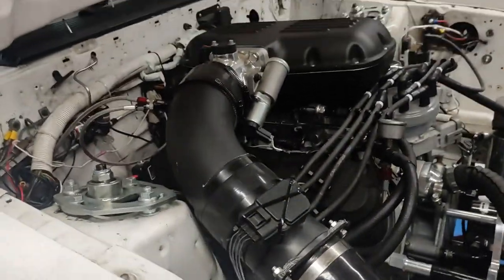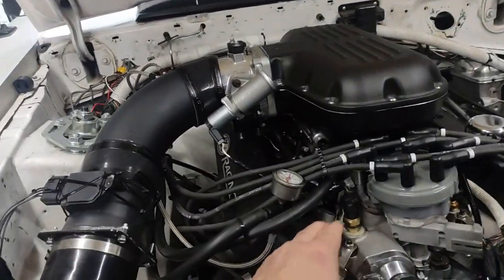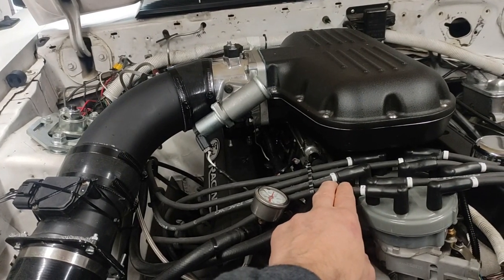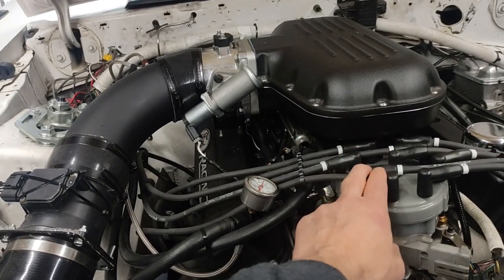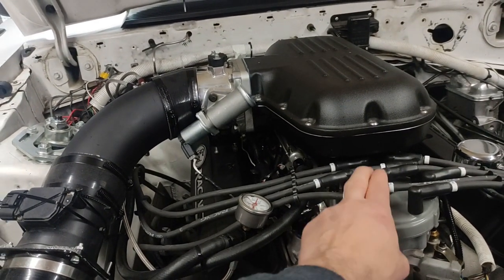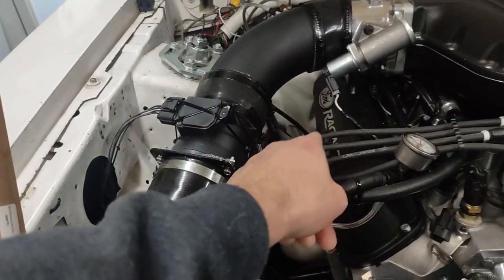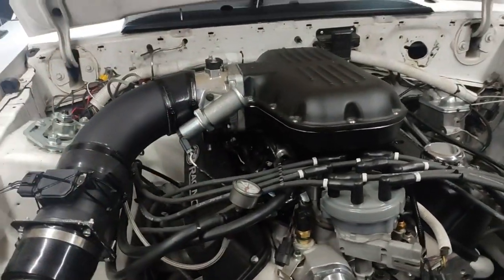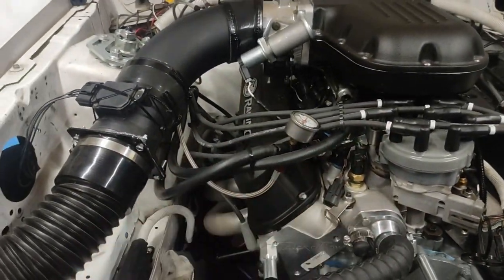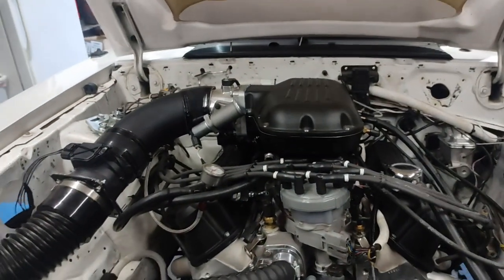I did place a small order with Summit. I have a feeling I retired these Ford Racing wires about a year or so ago because I thought I was having misfire issues with those. I put them back on and was having a little bit of misfire issues — but again, I don't know if it was from that or a fouled plug, because the car just idles most of the time. So anyway, I got a new set of plug wires and plugs coming, and then we'll do an oil change, and then we'll be set to go to the track.